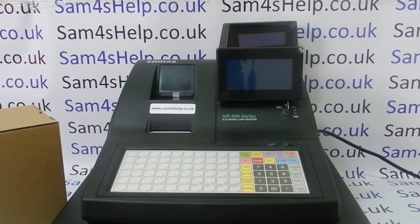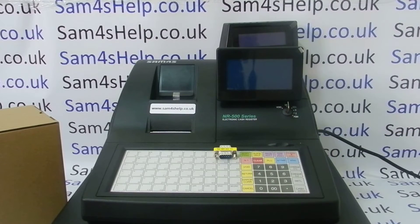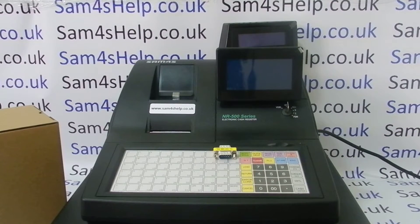You'll need a few things to get this to work. You'll need your new barcode scanner. We recommend using a serial connector barcode scanner, so you'll also in all likelihood need a gender changer. All the scanners seem to have female connectors on them, so you need to change it to male because the serial port on the side of the registers are female as well.